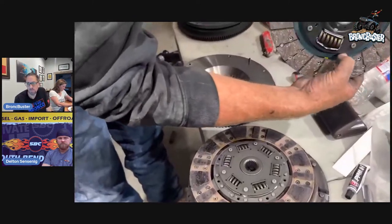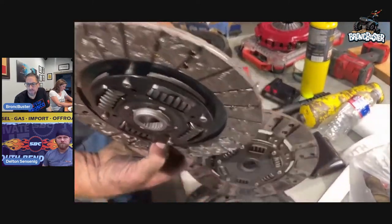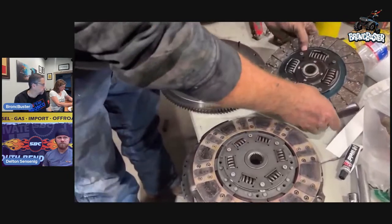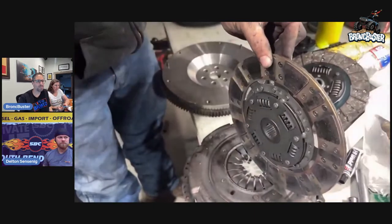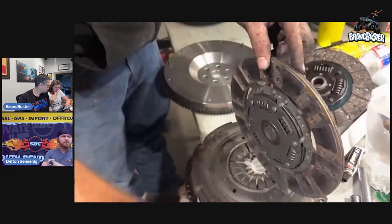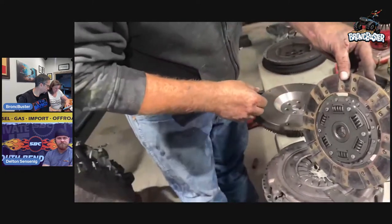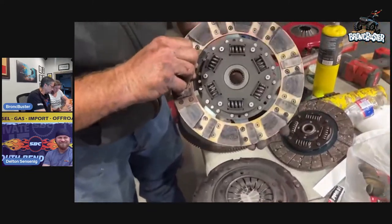This is a much more solid, more rigid plate. This has just a few more moving parts in it. That's what's called a self-adjusting clutch. Basically, as you wear through this, your pedal stays the same. Back in the day, people will be familiar with the more wear on this, the further the clutch pedal goes to the floor to engage or disengage the clutch. That's why when your clutch is gone, you're on the floor almost. So LuK Clutch came up with the self-adjusting.